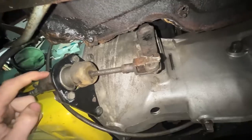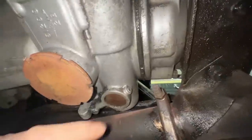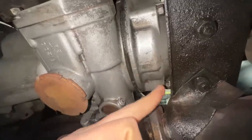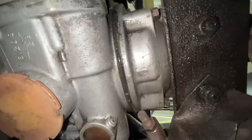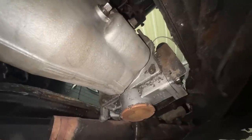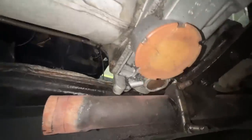I'm under the car here to install the slave cylinder and this plate here, which I did install. But I noticed on the transmission that we already have oil collecting on the brake plate of the overdrive. I remember this leak that I wasn't sure would be fixed by just tightening the bolts - looks like it wasn't. That's the only leak we couldn't fix. There's no drips on the floor yet, so hopefully it's just a very, very slow leak. There's no way to fix those without taking the overdrive apart. We will see when we start the engine and test drive it if it's going to leak more or just stay wet like this.